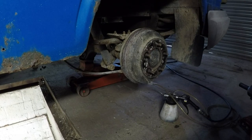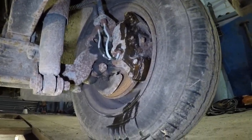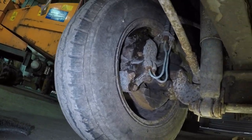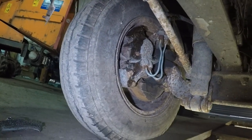Well folks, I've tried pulling the fluid through but to no avail — it just won't play the game. So I'm going to go to the front calipers and open those bleed nipples to see if we get anything coming through those, because I suspect the master cylinder may be faulty. I just cracked that very top bleed nipple off. This is actually a four-piston caliper, which is quite sexy for a crappy old van — and that one streamed fluid out straight away. The other one was a bit more reluctant. So what I'm going to do is use the bleeding tool and pull some fresh fluid through this side and see if it helps to get it to go down to the back.